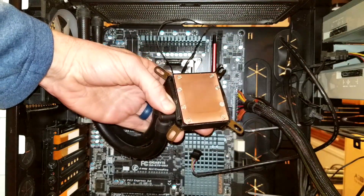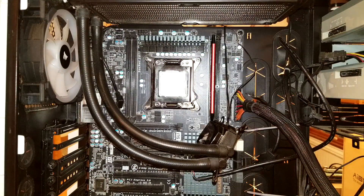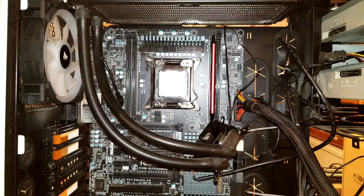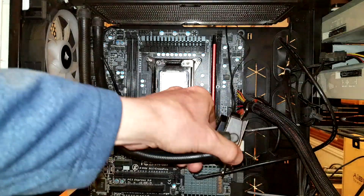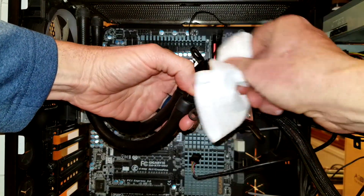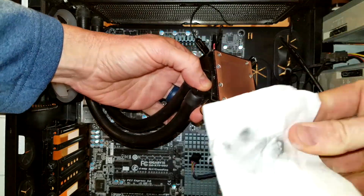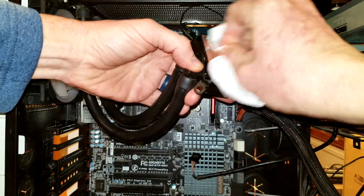There's a lot of gunk on this depending on how long that compound has been on — and now it's nice and clean. The next step is to grab some isopropyl alcohol; I'll link some in the description box below. Isopropyl alcohol is not going to hurt your computer, but we don't want it really soaked — just get it nice and damp. Take the napkin and clean the cooler back with that damp portion. We want a beautiful clean surface, and the isopropyl alcohol gets the remaining residue right off.